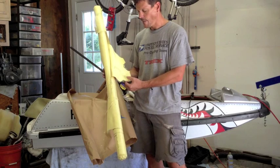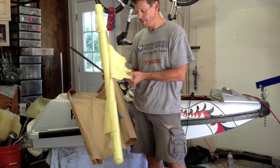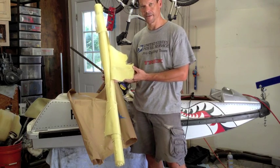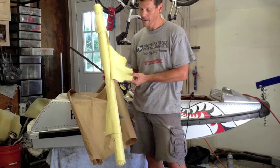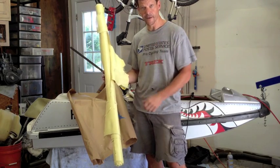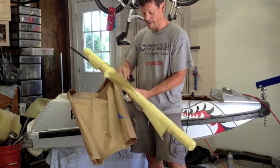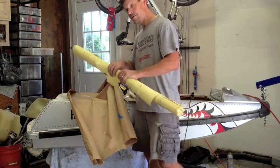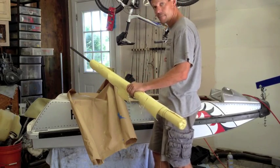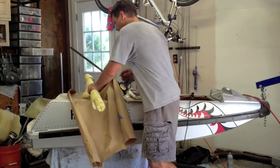This is Aramid 354, and as far as the weight goes it's a 7.5, but because it's Aramid it's a lot stronger than glass. I don't know what that equates to in glass, but I'm guessing it's probably at least a 15 weight. Maybe somebody in the comments who knows more about materials can post that. That's the Aramid, which we'll see is going to go in the bottom of the engine bay, and I also used it in little reinforcements on the sides when doing the foot levels.